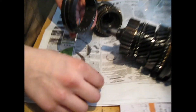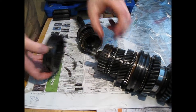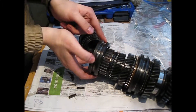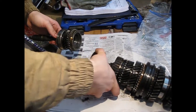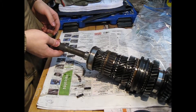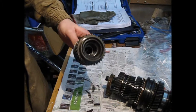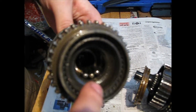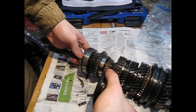The outer part of the sleeve is fixed like this. After you have inserted the three pieces, it goes in its own position. Insert this part and that's it. Do not forget to place the needles in the needle bearing like so, and then insert the piece there after putting the sleeve in its place.